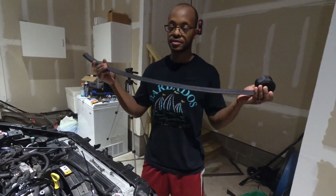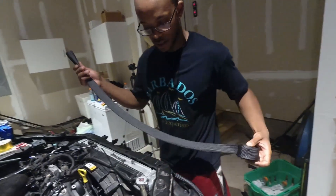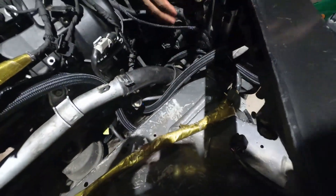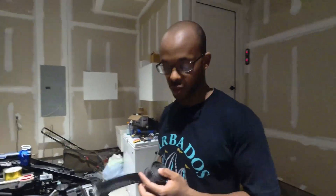Please go ahead and use it every single place that you can. We want thermal sleeve from all the way about here, all the way through and up to the connector. You do not want to melt this — this is very, very crucial. Very important.